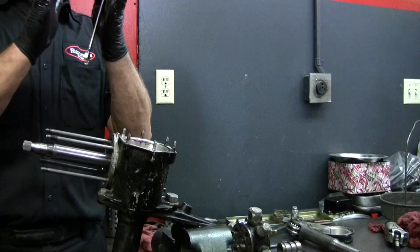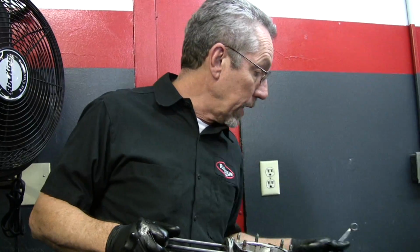When you said they upped it, was that to make the steering turn easier for somebody? Right. The pressure on the pump is a lot higher on the 3. And then the valving is different. It doesn't have all these springs and things. It's just a solid fit, so it moves back and forth and seems to move easier with less effort. That's the idea. You have to use effort to move these springs and all that.